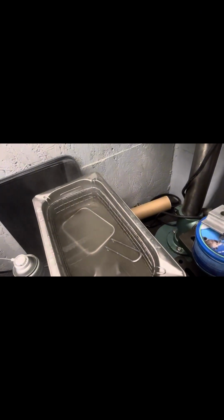I've also got, you can probably hear that noise, which is the ultrasonic cleaner. I've got the 350 out here with the carb off. That's still covered in oil from where the person who owned it preserved it for all the time. And in here we've got the carb cooking away there nicely. It started with a bit of carb cleaner down the carb, but it didn't want to start properly. I think the pilot jet was blocked, so that's another little issue I'm dealing with amongst everything else.